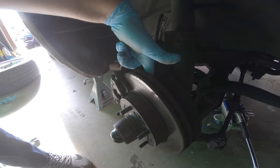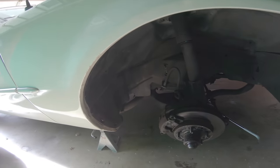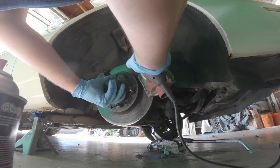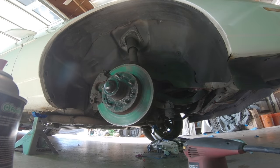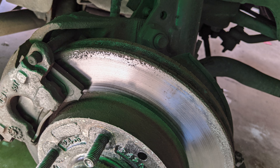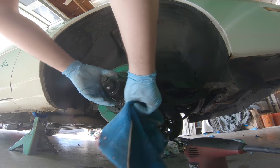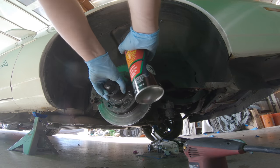After taking the wheel off and taking a close look, it was pretty evident why. This car had been up in Ohio - it's a snowy climate up there. It's originally a Florida car, but it had been in Ohio for about two years or so. And during that time, a little bit of rust had set in on some of the surface parts. There's no rot in it - there's nothing wrong with the car itself, it's still a solid, rust-free car. But things like the brake discs and rotors were rusted - pretty badly pitted. To the point where it was actually affecting the braking of the car. So I did a quick bush mechanic fix where I sanded down some of the rust and pits so that I could at least use the car and not fear for my life. That kind of fixed it, but it wasn't good enough.